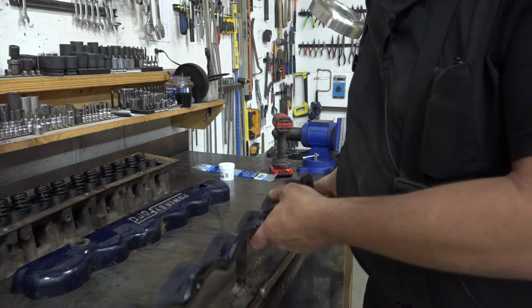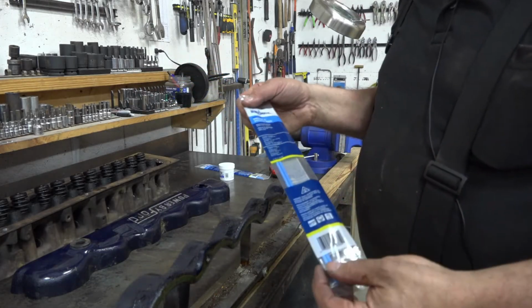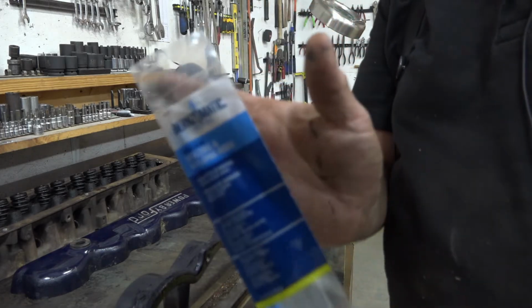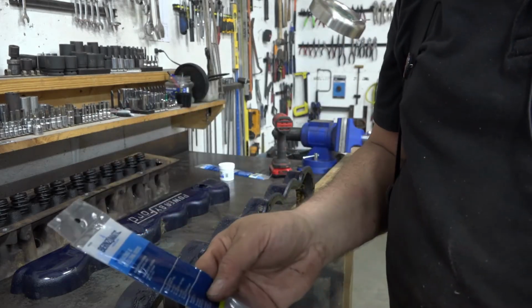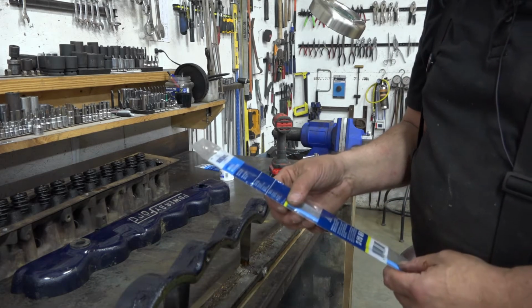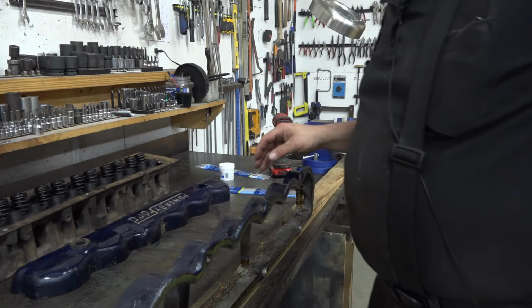But obviously I'm not a welder. So I didn't know that when you're doing thin sheet metal like this, they say the best thing to use is a nickel silver rod. I don't know if we can see that very well, if it'll focus or not. But rather than being a brass or a bronze rod, the rod has a high nickel and silver content, so that is supposed to braze a whole lot better and flow better when you have the flux in there and everything's nice and clean.